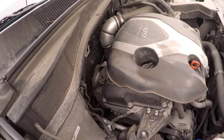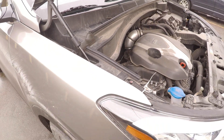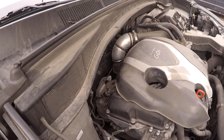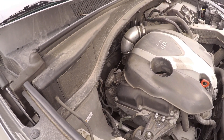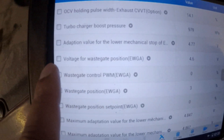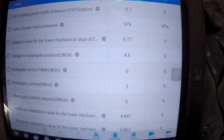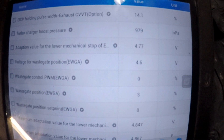So what's going on is we're waiting for the engine to cool down. To adjust the sensor, the car needs to be stone cold, and as of right now it's not — I can touch it, it's hot but not stone cold. The wastegate voltage is currently 4.6, and the target is to bring it down between 3.9 to 4.1. That would be ideal.